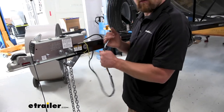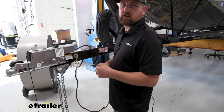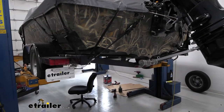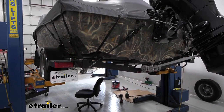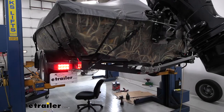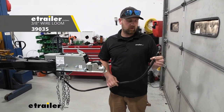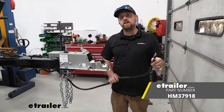Really, aside from taping everything up and getting it clean, that's about it. If you have the rest of your lighting system hooked up, it's not a bad idea to test this too to make sure all connections are good. I plugged into a test box — you can use your tow vehicle too. We'll try our tail lights, our left turn signal, our right turn signal, and our brake lights. I simply taped up all of our connections and put on some wire loom to help clean up the install. And with that done, that'll finish up our look at and installation of the Hopkins 5-Way trailer connector.